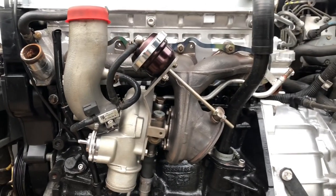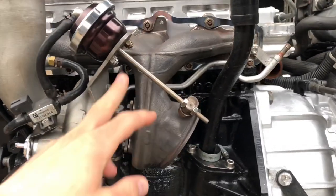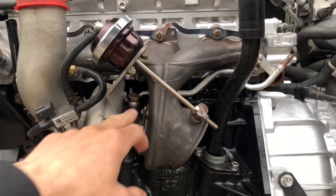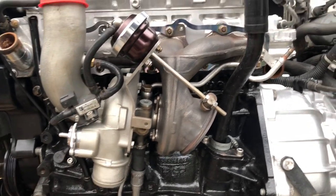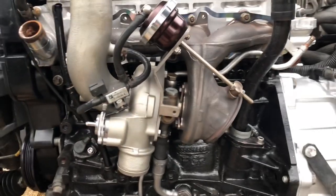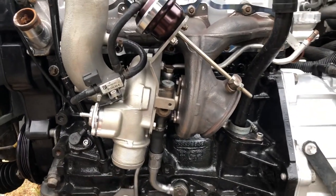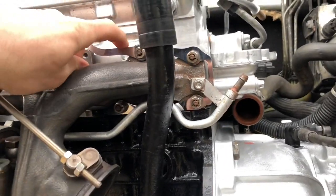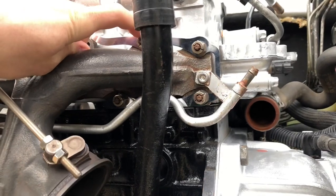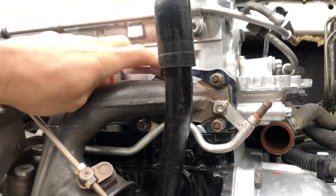Just bolting on parts now. You can see the turbo's fitted on there, all set up properly with an actuator. I changed this arm not long ago for a stainless actuator arm at the perfect preload at the max setting - it's just like a shortened arm. I've got the forge recirc in there at the minute but I might change to the turbo smart one. Brand new washer on there and aero nuts - I always use these aero nuts because they never ever come undone.